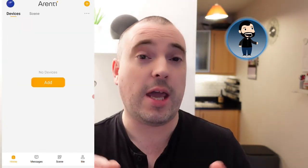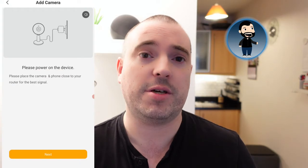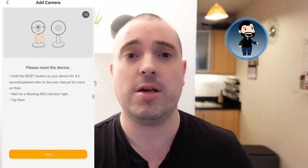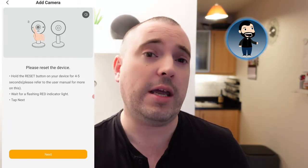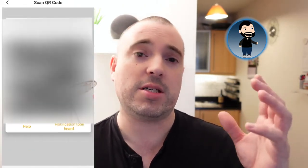The setup is fairly straightforward. The Arenti app is very similar to the Tuya Smart Life app, so if you've used that before it'll be a very familiar interface. When you search for the device, it gives you an on-screen guide and voice prompts. Like newer security cameras, it displays a QR code on screen that the camera scans to initiate setup — really handy and quick. The only thing to be aware of is that this device only connects to 2.4GHz networks. You'll need to disconnect from 5GHz and connect your phone to 2.4GHz, which might be a little frustrating for people unfamiliar with switching frequencies.